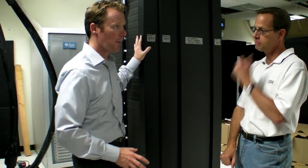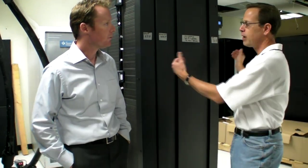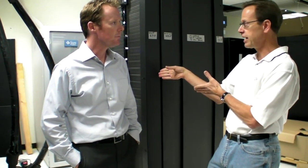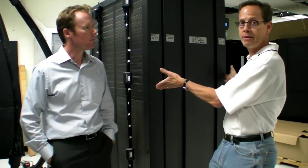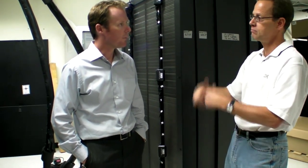The last point is that you can operate this without the rear door heat exchanger. In some legacy environments, if you wanted it cooled via room air, that's possible. Yes, totally — that's completely possible. If you were to buy this system, or pretty much any one of our IBM systems, and then decide you want to deploy a rear door heat exchanger technology — which we have on pretty much 100% of our products — you can come in and put this in within the same footprint. It just takes off the old door, puts on this door, connects up your two water pipes, and you're off and running.